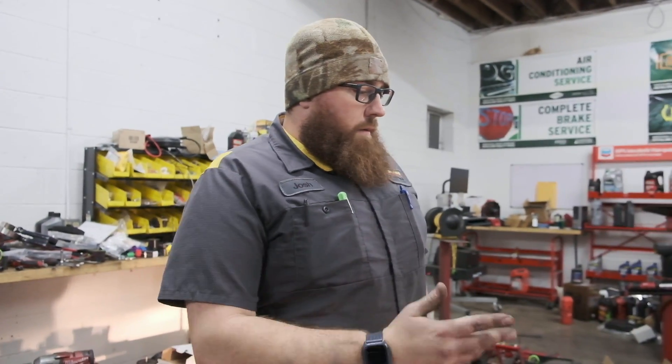What's going on guys? Josh here at ACI again. We just finished up the A4 that tried to fight us with wheel bearings and we replaced the speed sensor that broke last time. We found the water pump leaking and we're doing a water pump to it. We did the water pump thermostat housing assembly, a new water pump belt running off the balance shaft chains. Remember that bolt is left-hand threads so it does not come out the way you think it does. We'll also cover the failure points of how they failed with the o-ring blowing out. We replaced the union, new antifreeze. We did find the radiator leaking this time as well so I'll be back for the radiator.